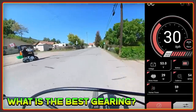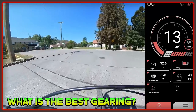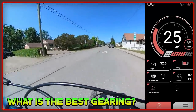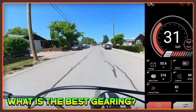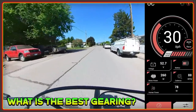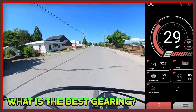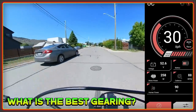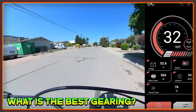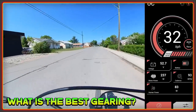What is the best gearing for the bike? I've had loads of questions regarding the gearing options — there is a 32T, a 38T, a 42T and a 50T. The choice depends on the rear sprocket you have to some extent. The ideal for most people is if you have one of the really wide 11T to 50T rear cassettes. With that you can have a 50T and get the best of everything — superb climbing ability as well as the option of going really fast on the flat. I'm using the 38T mostly because the largest gear at the back is 32T. I still wanted good climbing power and felt the 50T would not have done it for me. I've found it to be OK for climbing but still not quite optimal — a true 1:1 would I think be better for the steepest hills.